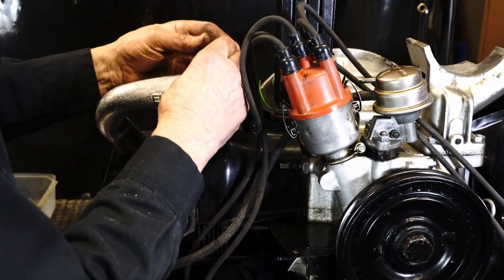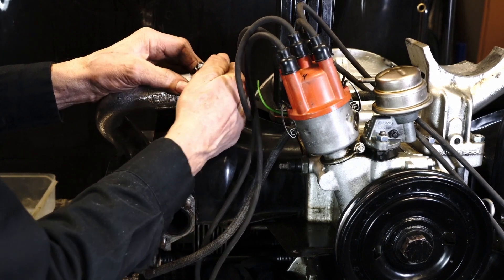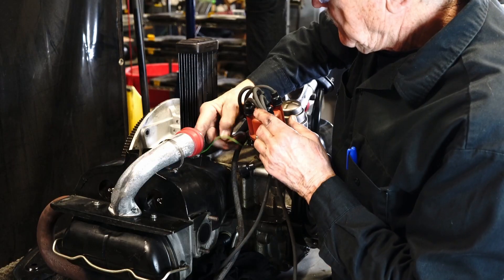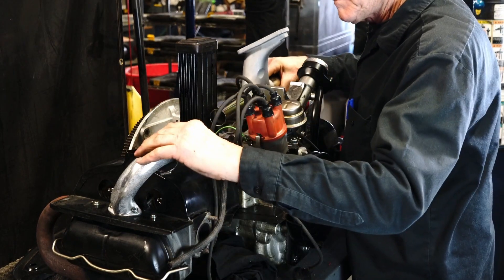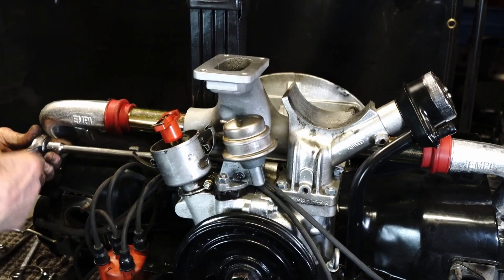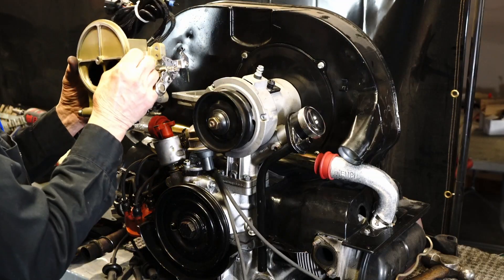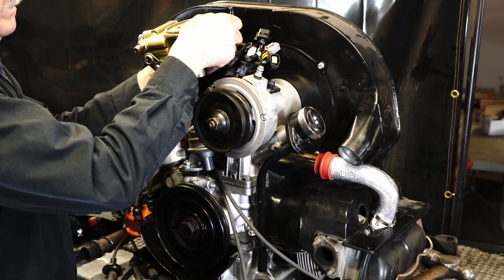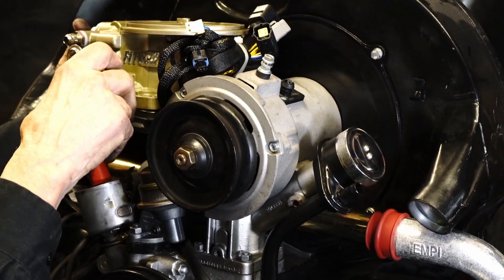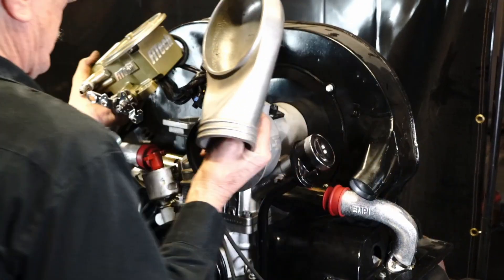In preparation of designing the adapter plate, we've got to put the intake manifold together on the engine so we can mock up the fitment of the throttle body. We are using a Weber progressive style intake manifold, as it is very close to a 2300 flange, which will make the adapter plate much easier. We are test fitting the throttle body onto the intake manifold to see how high we have to raise the throttle body to fit next to the alternator.